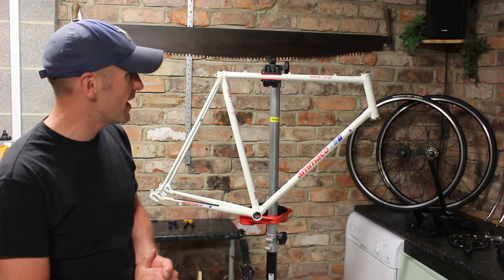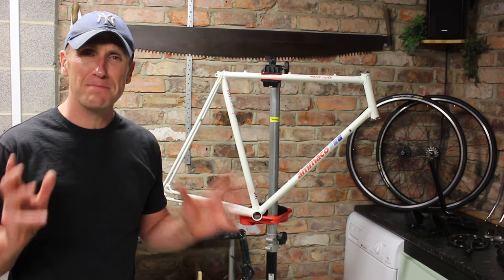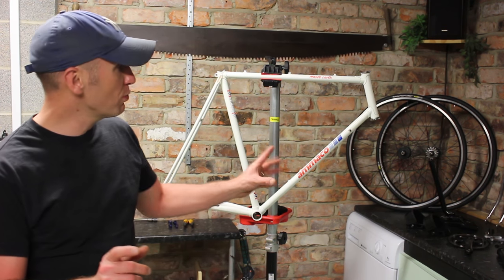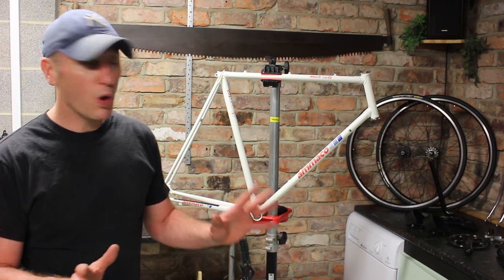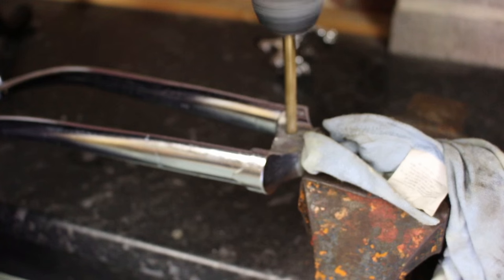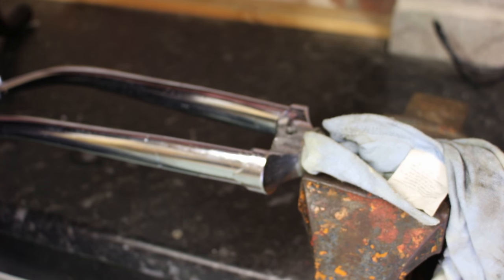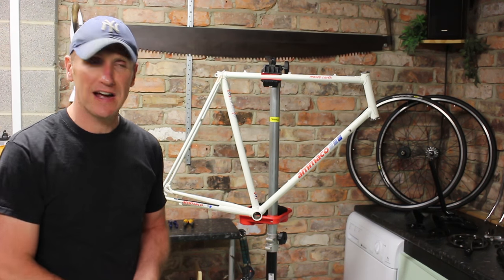What I've decided to do with this bike is make it a single speed fixed gear, simply because there were so many mixed parts — the forks weren't original and the brake calipers were completely different. I had a couple of wheels available to keep the cost down. I've got some nice new dual pivot brake calipers, so I had to drill out the forks and the frame using an 8mm drill bit, which just accommodates the locking nut at the back and fits in nicely.